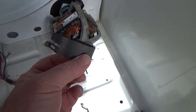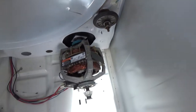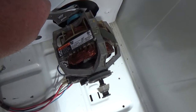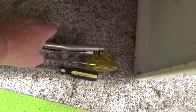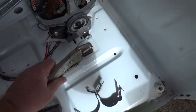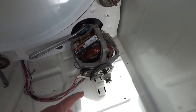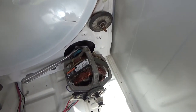I took the back clip off — here's what that looks like. It goes on the back of the motor with the clip part to the front. By taking it off you can see the back of the shaft. All you have to do is take a wrench, slide it on that shaft to hold it in place, then tighten the fan with a flat-jaw tool. The mistake I made was putting the clip on, which covers up that access port.